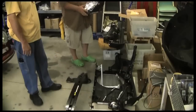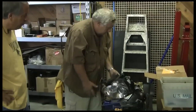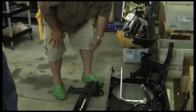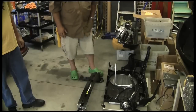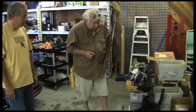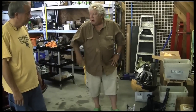We do have some immense and actually quite beautiful headlights. These things have their own washer system — right here. There's an actuator on this side; it pushes out and has its own pump in the reservoir, which is also for the windshield washers. These are some of our air conditioning components. It has a radiator for the engine cooling and the condenser for the air conditioner. One of the things we're going to do is replace the motor-driven compressor with an electrical air compressor that will operate off our pack voltage at 300 volts.